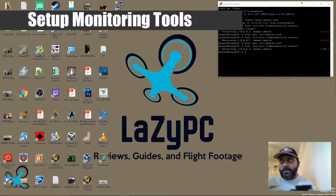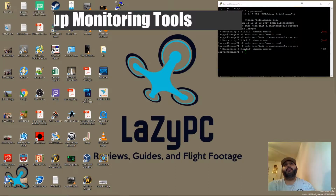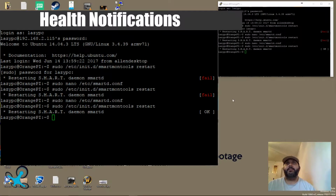So what we've done is we have got our OrangePi NAS up and running. We've gotten the hard drive partitioned and shared, and now we have our monitoring tools going. The final thing we need to do is get our monitoring tool to send us an email just in case something goes wrong. I've got a hard drive with 15,000 hours on it, so I might want that to happen. So the last thing to do is configure Linux to send emails.